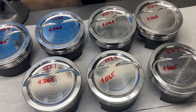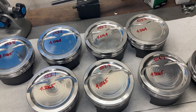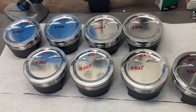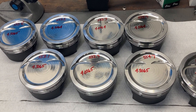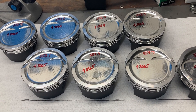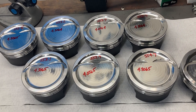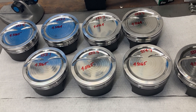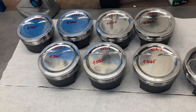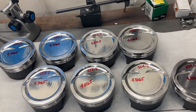I talked to Mr. Molnar over Instagram Messenger the other day — he saw one of my posts and wanted to thank me for my business. He noticed that I weighed all the rods and said whatever you do, do not grind on the big end fins on the rod cap, because doing that can weaken the rigidity of the rod. I told him I very rarely grind on anything to weight match. Instead, you can mix and match components and get the bob weights pretty close to each other.